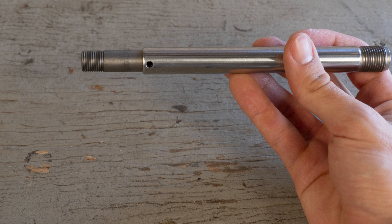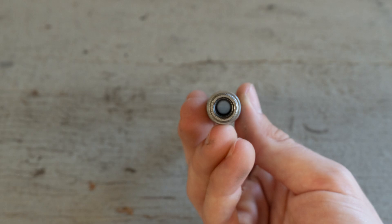The last shaft here has an adjustable bypass feature, also known as rebound adjustable. It has an internal metering feature with different components added inside the shaft so bypass can be adjusted externally. This feature can be identified by a through hole traveling through the entire length of the shaft.